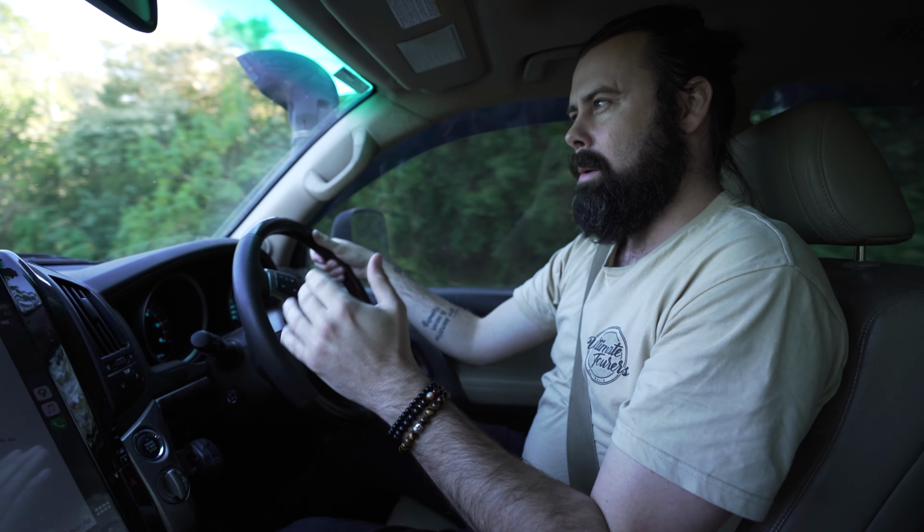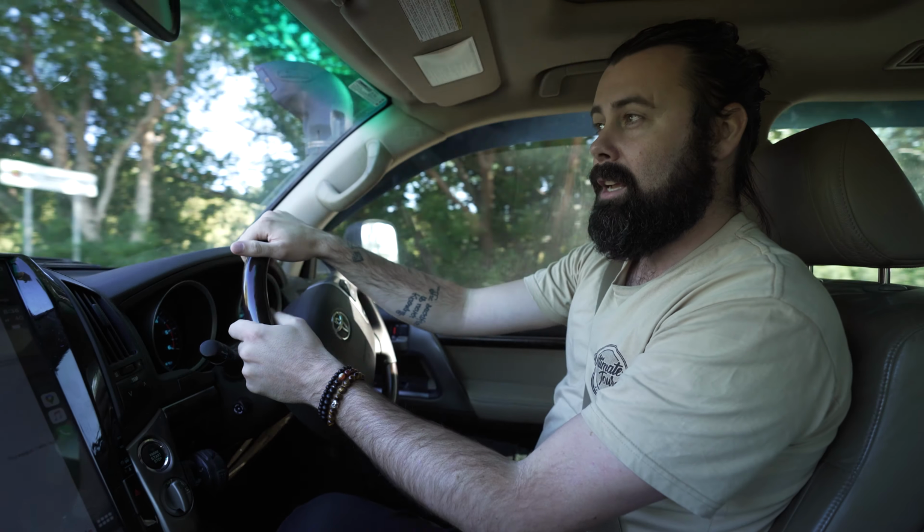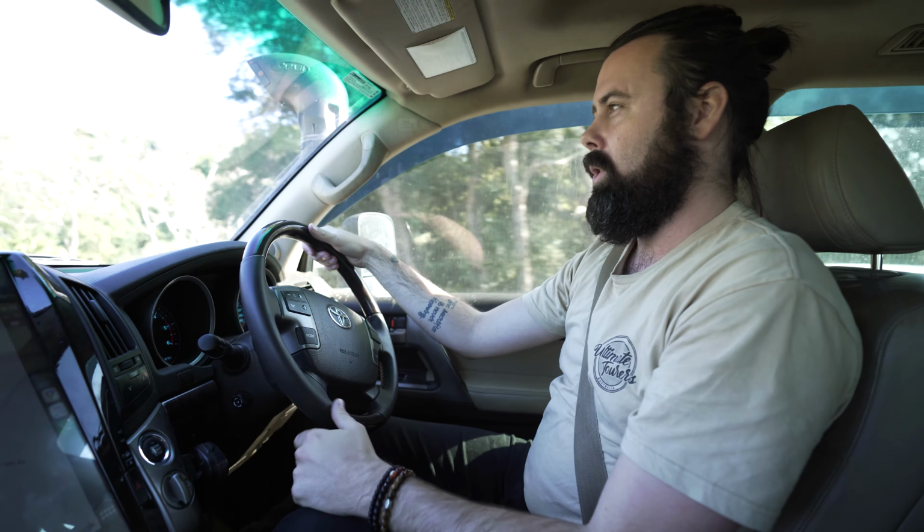That's really, really important, because the second rule is that you want to keep your engine RPM above 1500. If you have your engine drop below 1500 RPM, the issue is it will put a lot of load on your drivetrain. The car will start to shudder. It's like driving a manual car being in fifth gear trying to do 20 kilometers an hour. It's not good at all.